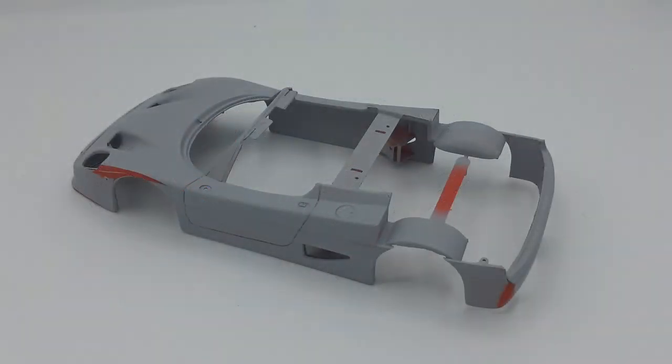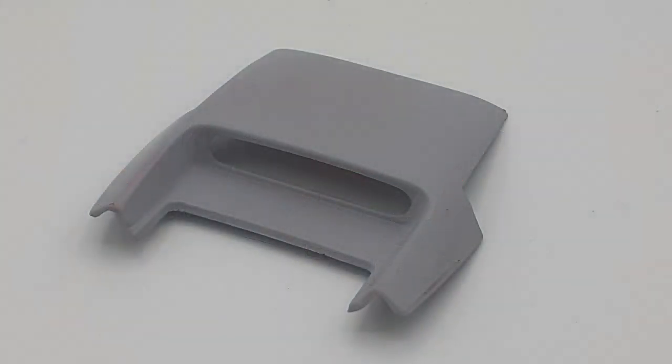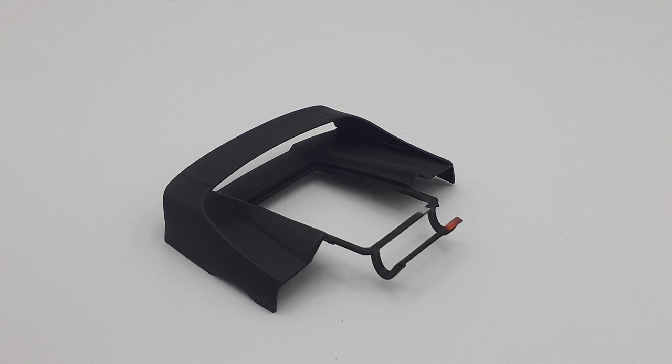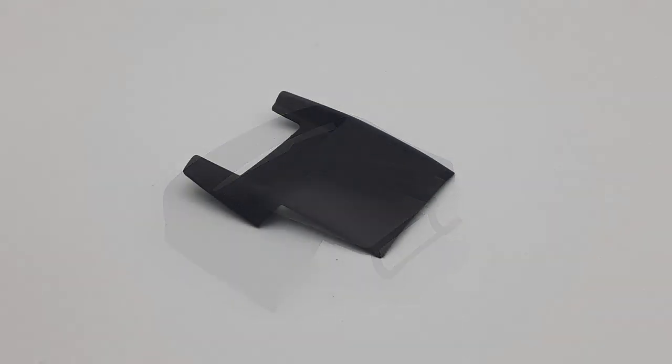I did notice the wheel arch there just over the left front wheel needed a little bit of shaping, so I gave that a light sanding as well. Removable top and hardware there, they were fine. Just primed those and got them ready to dry. This time I sprayed the rear deck lid there in black as an undercoat for the gold base. Same thing for the other related pieces.